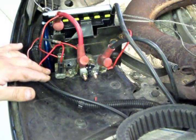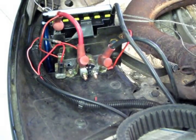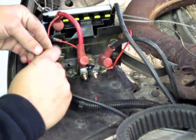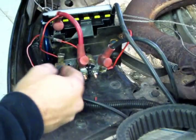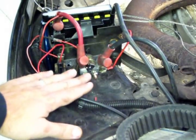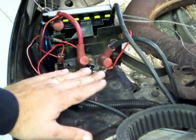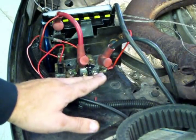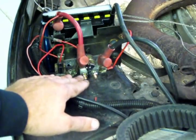Now if this fuse ever goes bad on you, the easiest thing to carry with you is an automotive fuse that is amp-specific. That's an 8 amp fuse, so you want to take an 8 amp automotive fuse, and if this goes bad, pull this off, hook that in, hook in the other side, and you can get away with getting back to wherever. Make sure all of your connections are clean and tight, otherwise you'll run into charging problems after they start to get corroded. So every year — at the beginning of the year, at the end of the year, and maybe the middle of the season — go over all your connections and make sure they're clean and tight.